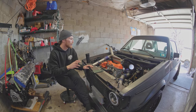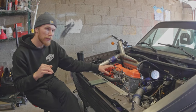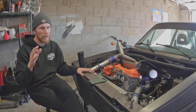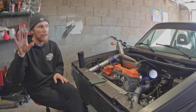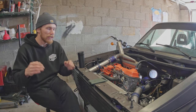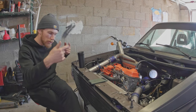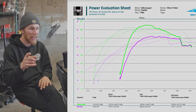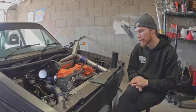A few years ago when I dynoed this car my setup was the original manifold with a GT2052 turbo, original intake manifold, and an intercooler — turbodiesel pump with no governor and increased fuel tuning. Without a propane adder I was making about 75 horsepower to the wheels. Wheel horsepower and crank horsepower are completely different things — people who sell you parts always advertise crank horsepower because it sounds higher. With all that tuned up we got 75 wheel horsepower. Then I threw some propane at it and got to 80 horsepower, threw some more propane and bent the rod. So you can see it's kind of a fine line.